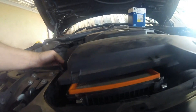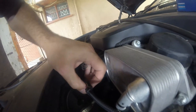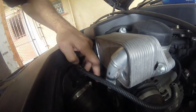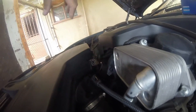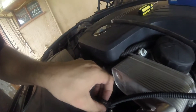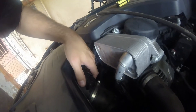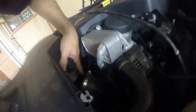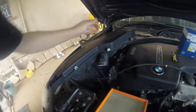There you can see the filter at the bottom. Next step you want to do is remove this plug here as well as the clamp there, so that the box can slide out. You just pull back on the clip there and pull it out. Just loosen that and then you can just pick up the filter box like that.